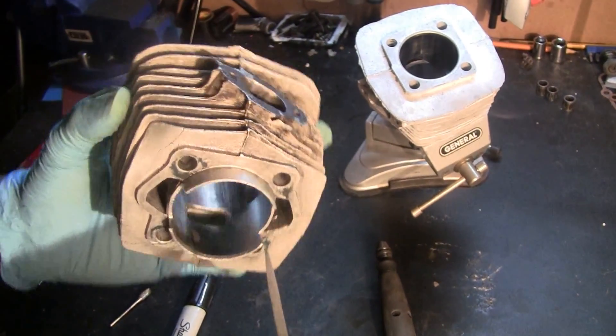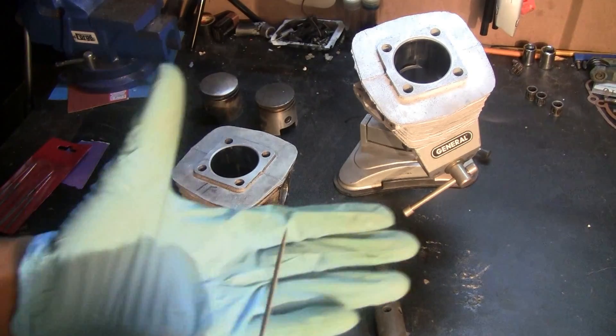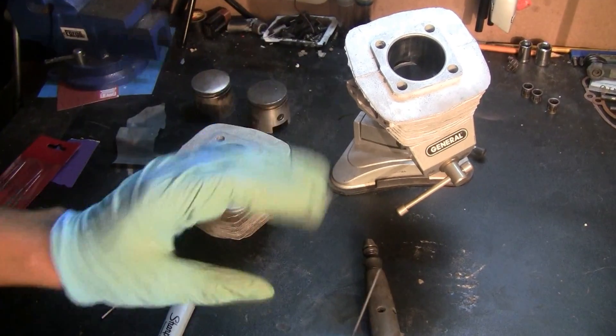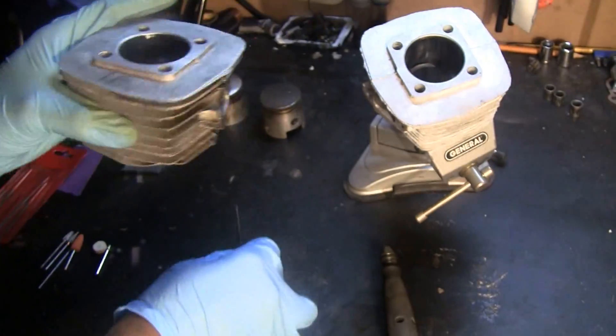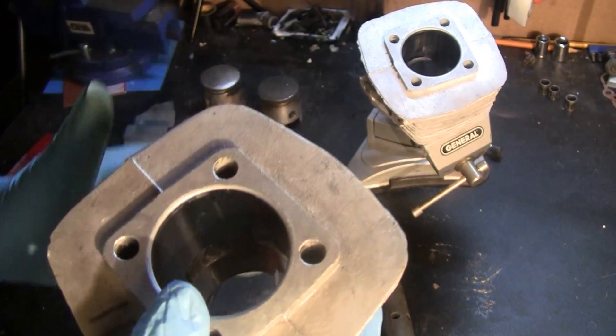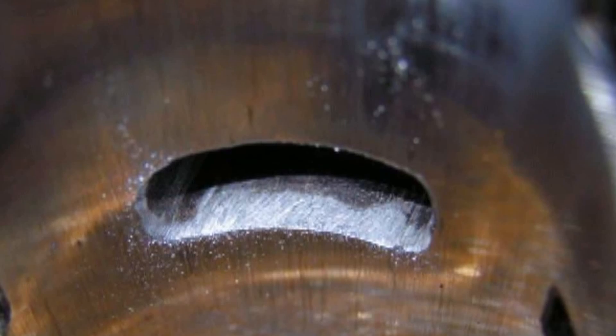Port work takes a little time because you really need surgical precision. You have to take your time and make sure you chamfer all the edges inside — this is all for the exhaust port. I'm going to show on screen an example of what rounding the edges should look like. Notice how along the walls everything is rounded out — that's the effect you want to achieve so your piston ring gets enough clearance and nothing gets hooked.